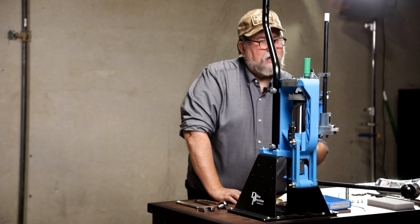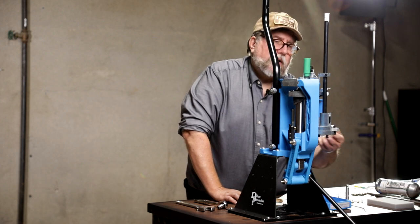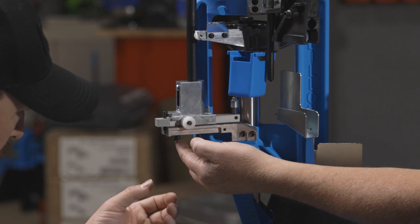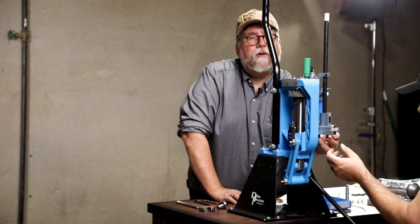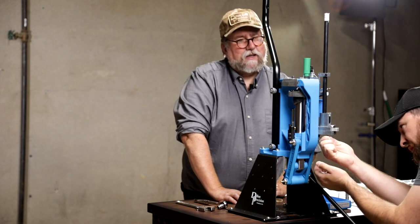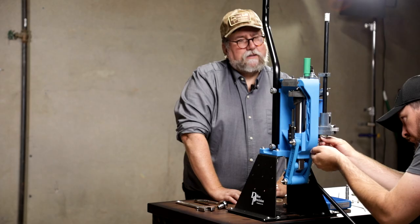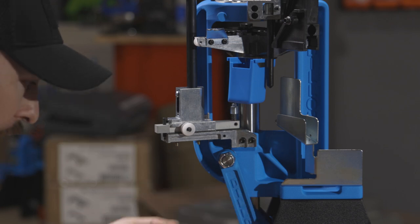Okay, now pull the handle down the rest of the way. Okay, full pull now. Got it. Okay, let go of the handle. Now, there's two thumb screws that go over studs that protrude out the bottom of the housing. Remove those. Be careful not to lose the washer above them. They're small, they disappear easily. Okay, real little guys, I see those there. I'm going to set these aside in our blue. Might as well use it. Right there, yeah. Convenient. There we go, got them.